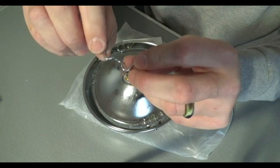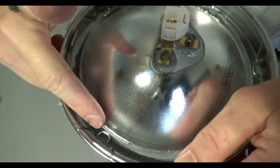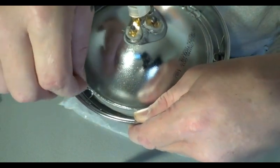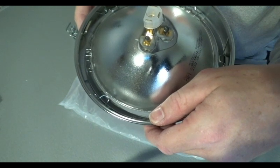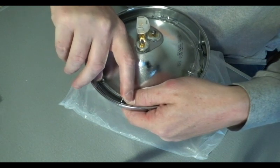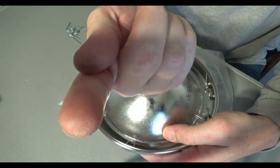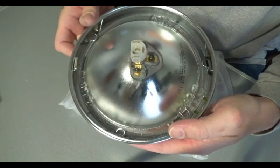To install a clip: take your clip and place it on the inside edge of the headlight on the outer rim, right there on the outer rim. Turn it sideways, get one side under that edge. A lot of people use needle-nose pliers — I usually just use my fingers. Grab the end with your finger, pull it down, and it'll go right into place. It takes a bit of pressure and may leave a small indentation, but it's not bad.